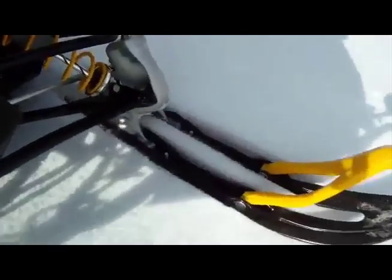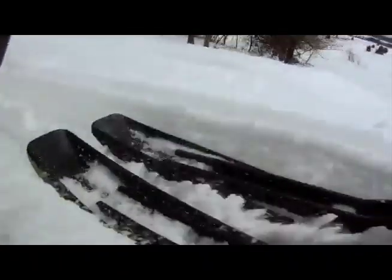One of the major benefits to the consumer as it relates to the split rail ski is how much slide rail wear is reduced. The ski has this unique capability that when you come into a corner, the inside ski hooks the snow, shoots it down between the rails, dumps it right on the front idler wheel, lubricates the slide rail and cools the sled. And this attribute, I can't stress how much it changes the wear. Our Yamaha Nitro that we have, we've got three times the amount of life out of the slide rail.